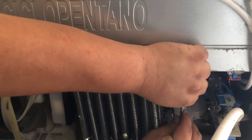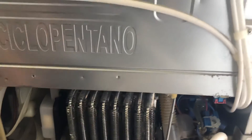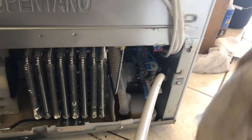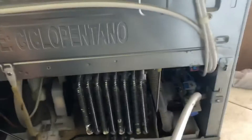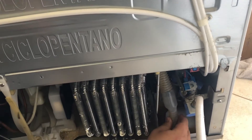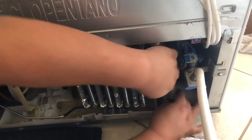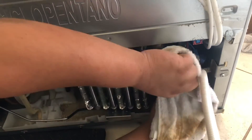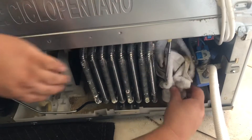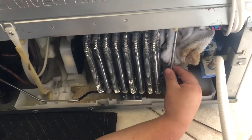Don't forget to sand it — we've already sanded it. I personally like grabbing a wet towel and putting it behind because when you're brazing, the heat — you don't want to melt anything. You can always remove it as well, but I always like putting it back there because the little tub is made of plastic and then you've got cables and stuff like that. For me, I prefer just putting it in there, cover everything, and that way it's a lot easier.